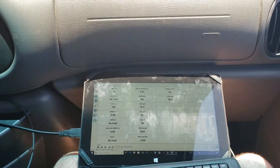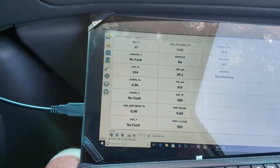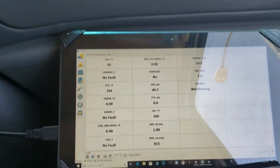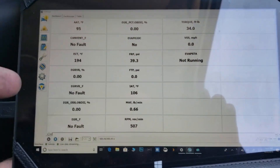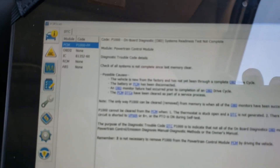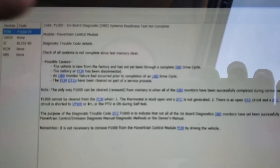And if it does, it should be good to get the emissions done on this thing. Just getting home, cruised up the road about 10 to 15 miles. I don't think it's completed the emissions readiness yet, but it hasn't faulted anything. The only code it still has is the P1000 because the test is not complete yet.